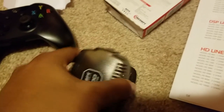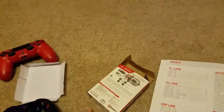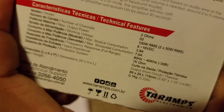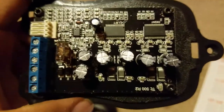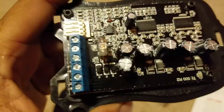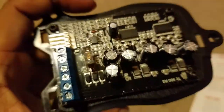This amp can be opened — there's a little tab right here. It turns out I didn't need to remove the high-level input connector to do that. Inside we have a 7.5-amp fuse, which goes right along with the 7.6-amp max draw — so you'll actually be pulling less than that in real use. Really, really compact amp. I like how the fuse is right there on the inside.